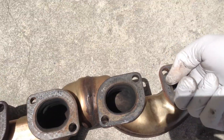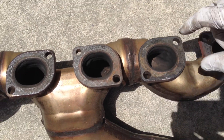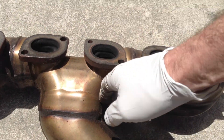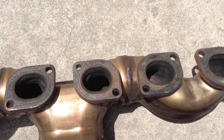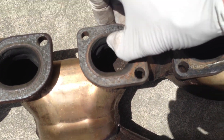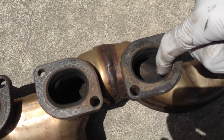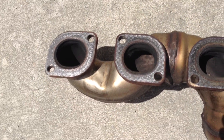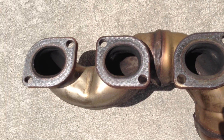This exhaust gas has to go in, through, and behind that wall to get around here. So it's kind of like almost a tubular header, but not quite, built inside this huge stainless steel shell. It'd be kind of interesting to just take a saw and cut straight across and look at it, but I don't want to do that. The only other thing from a flow standpoint is some of these welds are a little thick — you could grind them down and polish them, though I'm sure it wouldn't do a thing for performance. But that's a close-up of how the N73's exhaust manifold is made that you don't normally get to see.